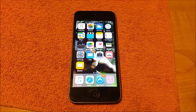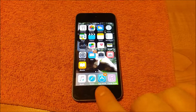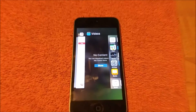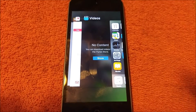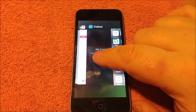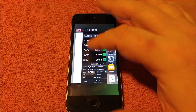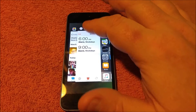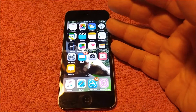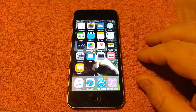A quick tip to resolve this issue is just simply double-tapping the home button twice. What that's going to do is open a window similar to this, and this is where all of your apps are running and where you can kill them. All you've got to do is simply swipe up with each one to shut those applications off. You can see there's quite a few that were up and running here. I just killed all the apps on this particular iPod, so nothing is running in the background currently.